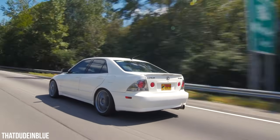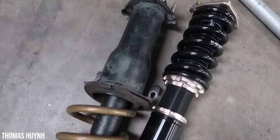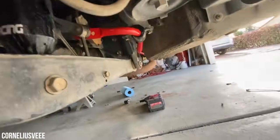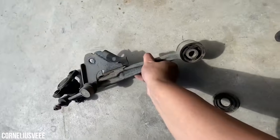The Lexus IS300 needs maybe four to five key mods to really dial in its driving experience. Remember the guy who helped make it came from the same ethos as the AE86 — it was light, nimble, just a little bit too slow, and this one has a little bit more luxury. So number one: coilovers are going to do loads for this car. BC Racing if you're going to track it, BR Series coilovers are $1,200 and the 500 Series are around $1,700. You will need to spend the money here. You can get a sway bar, but what you really need is to make sure your bushings are good — because they're probably not.